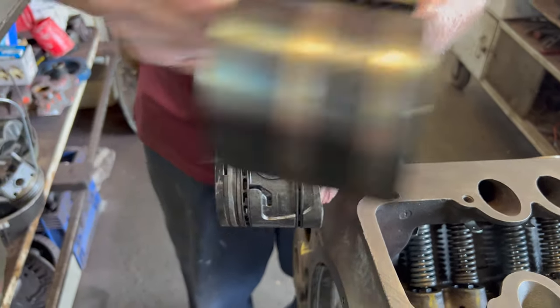For anyone watching, most of this will also apply to all Lincoln V12s — almost every bit of it. On the Ford flathead flywheels, the early flywheel has a lot of weight and only takes about a 9-inch clutch — it's also very heavy. We discard those and put the later model flywheel on instead, which is much lighter and takes up to an 11-inch clutch. When you put bigger, more powerful motors in, you definitely need a 10.5 or 11-inch clutch.